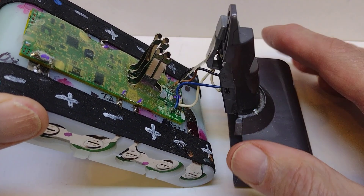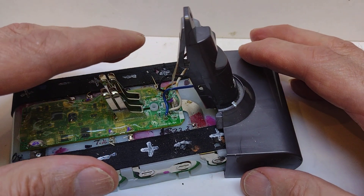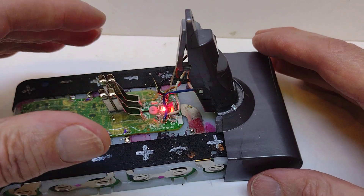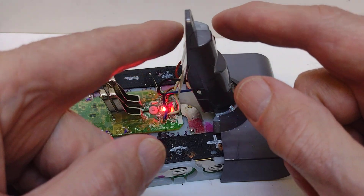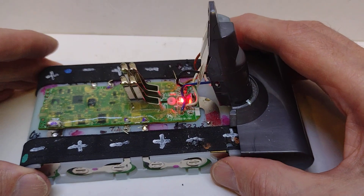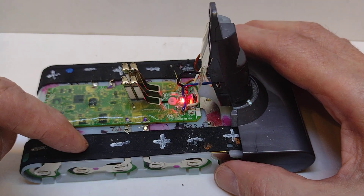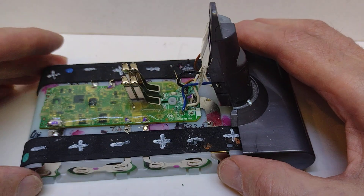We find we've got four wires coming onto the upright part of the battery case - two to the switch and two to the battery charger. The battery charger here is very difficult to get apart. I think the switch might have come off; it comes off very easily when you pull it apart and there's a spring underneath so it goes flying into the air if you're not careful. The cells themselves are arranged in series: this could be 0 volts, that's going to be about 4 volts, connecting to the next at 8 volts, then 12 volts and so on.